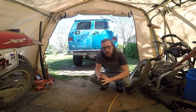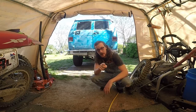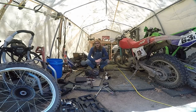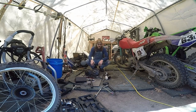I'm going to try to change the rear axle gears in one take of video. Got the press over there, tools behind me. Actually, fast forward — past me was wrong. I can't do this in one day. Turns out I had the wrong carrier. I didn't look up carrier breaks prior to doing this, and going from 3.15 gear to 4.10 is too big of a jump for the carrier, so I spent two days trying to shim this thing.